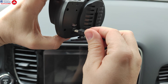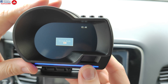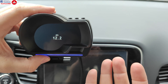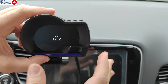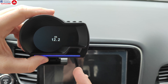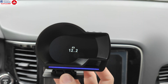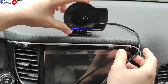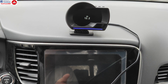Now for the interesting and fun part. The cable is connected to the OBD port and when I connect the device it starts up and puts me to select OBD mode or GPS mode. OBD mode works with the car's OBD data, while GPS mode doesn't use OBD but gives GPS information such as speed and heading. Nothing works right now because my car's engine is off, but it still supplies power on the OBD port — that's a bit strange. On most cars when you turn them off the OBD port is also off, but on this plug-in hybrid the power is always on.